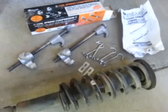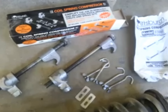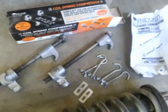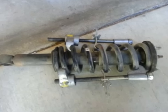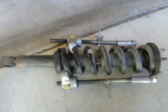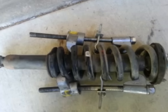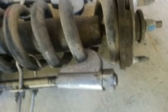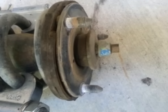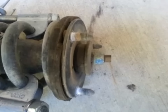The strut is now out and I'm going to use this coil spring compressor that was actually purchased at Harbor Freight. Read the instructions, follow the directions — this is really dangerous if you don't do it properly. Coil spring compressor is in place and now you need to tighten both sides evenly and carefully. Look at the torsion tension that's put on those bolts and they're bending — that scares me to death. So I started to loosen the nut on top, and I noticed that I was getting play underneath it, so I knew that I had the spring tightened enough.